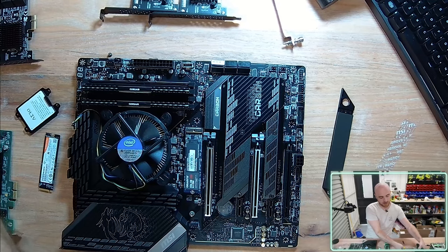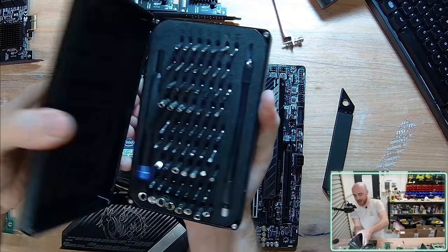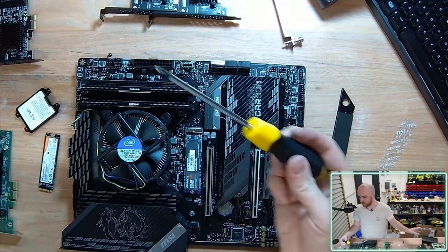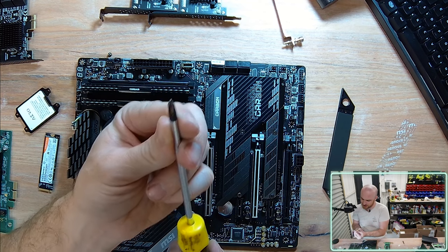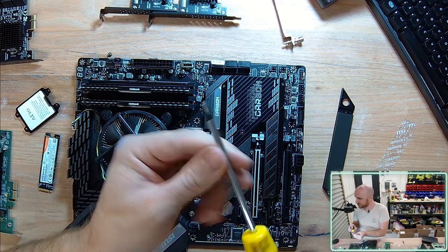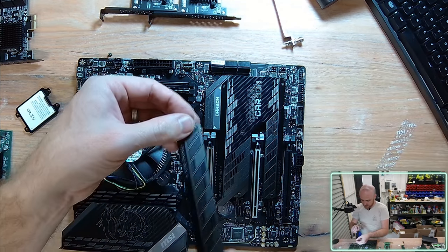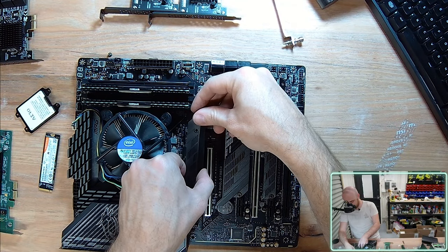It's a little bit intimidating for this video, I think, but I don't want people to feel like you need every tool under the sun to build a PC. Whereas in reality, most of the time, since forever, you've just been able to get away with the standard Phillips tip. I don't know what this rating is, if it's like a T1, I forget. I've never done full screwdriver analysis, but just a pretty standard Phillips head forevermore has gotten you by with PC installs. In this instance, you need a smaller screwdriver typically for your NVMe drives as well nowadays.